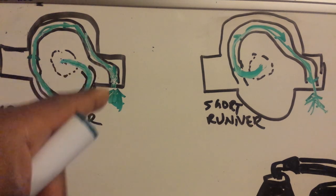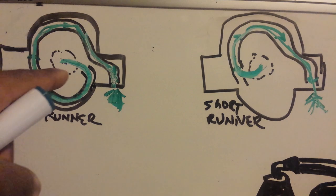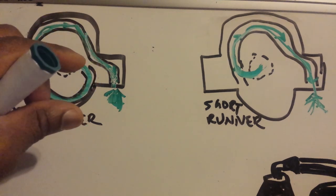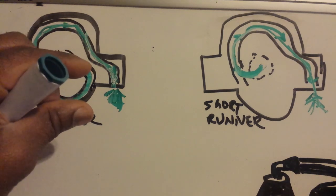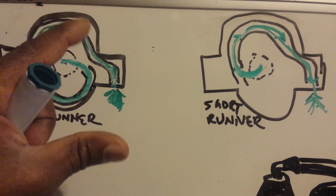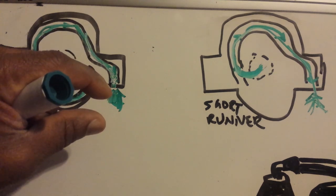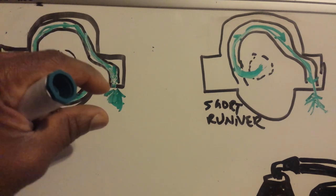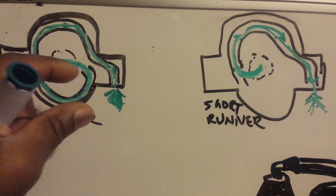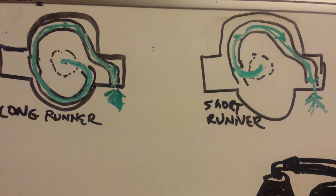And that's what's happening inside this intake manifold when those valves are adjusted just right. They're variable adjustments. It's not just an open or a close. There's an open and there's a huge variation in openness and closeness for that. And that's to achieve the Helmholtz resonance at all RPMs.